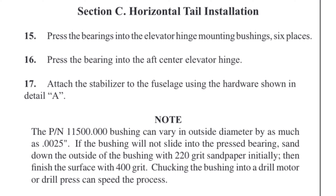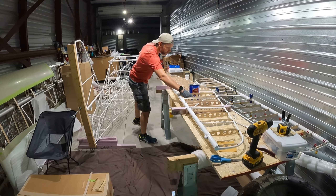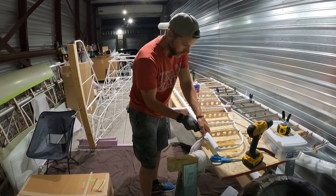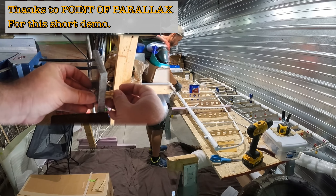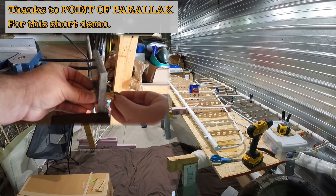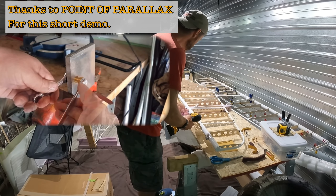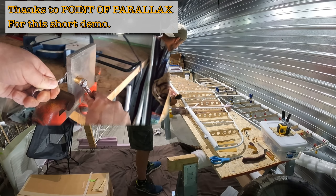I had a problem with this — it was my first time and I made a mistake with the first one. I tried to push it in but it wasn't sanded down enough, so you might see me tapping it with a wooden block lightly. I got a hammer out and said I'm not going to use a hammer. After searching YouTube, the best method I found is to get a longer bolt with a couple of small washers about the size of dimes. Put that bolt through the hole and through the bushing — make sure it's sanded properly so you can fit it in those holes with your fingers. Apply a little Loctite to cover the bonding surfaces, slide it in the hole, and if it's a friction fit and won't quite go in, tighten up the nut and washers on each end and it just pulls it right into the hole. Next time I do this I'll get a good close-up video of it.